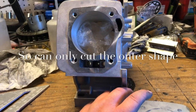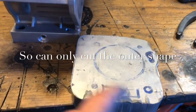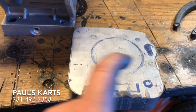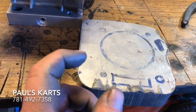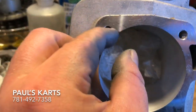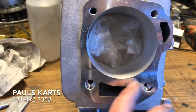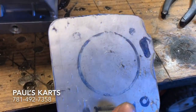We've ordered a Tillotson head gasket — the Tillotson head gasket will have all the repositioned holes in it and give us a better template. I don't want to cut any of this stuff out yet. One of the really hard parts is actually referencing these holes; you need to get these holes pretty much spot-on. There's a little play, but as you can see, there's really not much material — you don't want to be off say an eighth of an inch when you drill that hole. The bolts aren't going to bolt into this; they're going to still bolt into the block and just go through this deck plate. But you still don't want to mess up the hole.